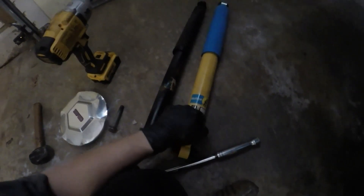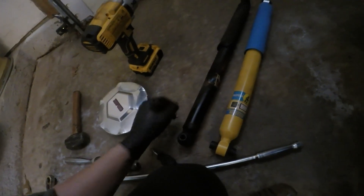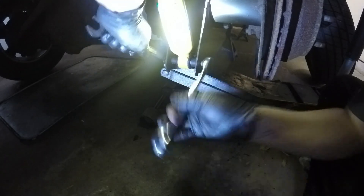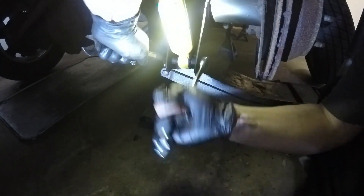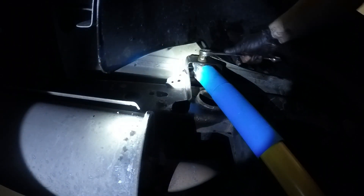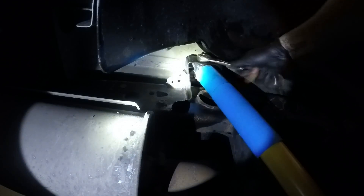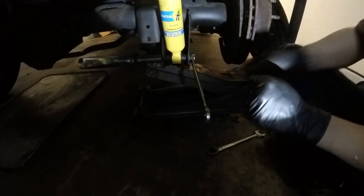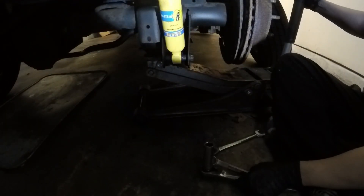Comparing the new one to the old one — this one's a little beefier compared to the OEM one or the old version of this Bilstein. Now we're going to place the new one in, get our bolt through, and snug it down. With that snugged down, we're going to snug the top down. And when this is tight, we'll put the bottom bolt in also. There's the top, and there's the bottom. Then you can lower the jack. And there's the rear — pretty easy, just two bolts.